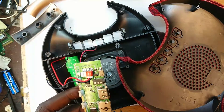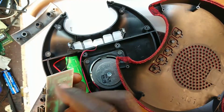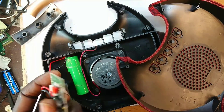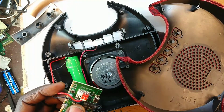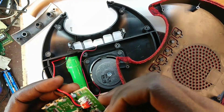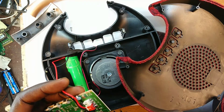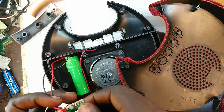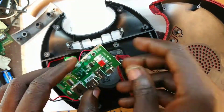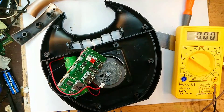This is not what he thought it was. Visually, when you look at the port it looks okay. But when you look at the terminals that receive power to the port — this is soldered, that is soldered — there are signs of breakage. Let me plug in a charger and measure voltage from the output side — that's another way of figuring that out.